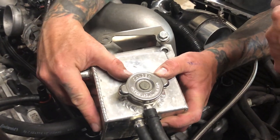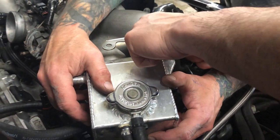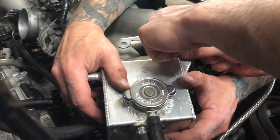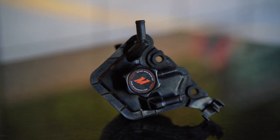So let's talk about the auxiliary tank first. The auxiliary tank — some variant of this — sits basically on top of the intake manifold, right above the turbo, and it has your upper radiator cap on it. The obvious function it serves is that it's the high point of the cooling system, which is why the radiator cap is on there. With the Subaru, burping the air out of the cooling system is more difficult and more complicated than on most cars.